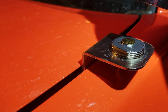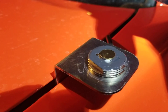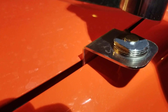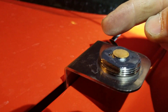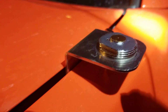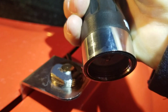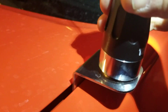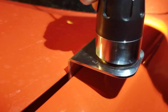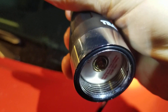It's a coaxial cable kit. Sometimes I use some sealant. You have to make sure the surface right here is perfectly flat, because this O-ring — if it gets damaged or if there's a gap — will allow water to ingress and cause corrosion, especially at the central pin here, which is spring-loaded.